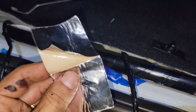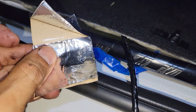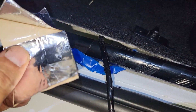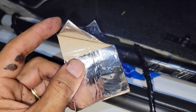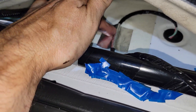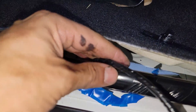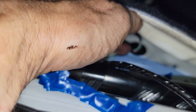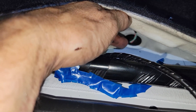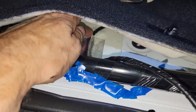Now guys, we have these pieces of aluminum tape. We have to attach this harness to the metal of the car using this aluminum tape. Look at how it looks right now — the purpose is to give it some play, just in case over the years the wire starts pulling. If you pull this, the gasket part is going to move out of the way and you won't have a waterproof seal. But using this tape, it's secured from here, and on the bottom with the zip ties, it's not going anywhere.